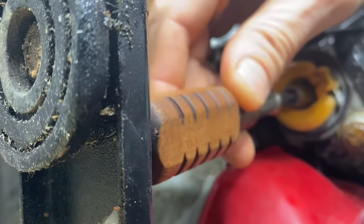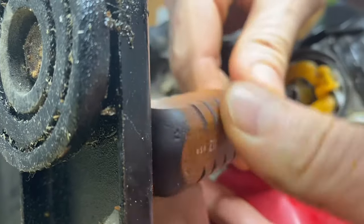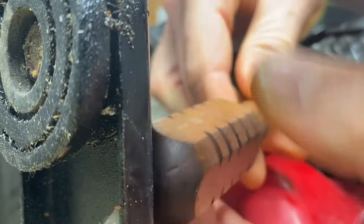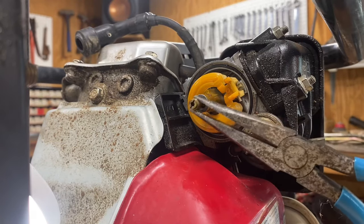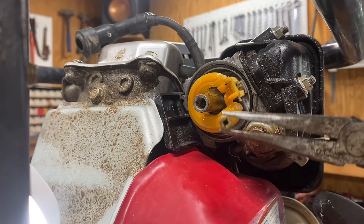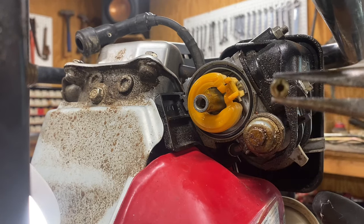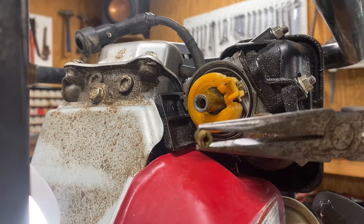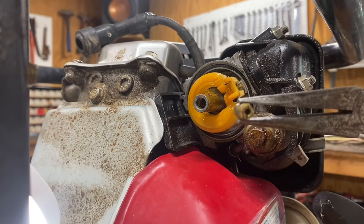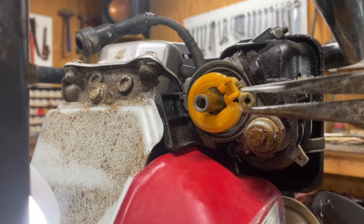Get one that fits in there - this one's just about perfect. It's going to take a little work - you'll turn it around, you'll feel where it grabs. It's going to be tight in there because there's a lot of carburetor goo and gunk. So I've wiggled this main jet out. You're going to screw it as far as you can, but after that you're going to need a little gravity to let it drop down. When you look at the main jet, this is what the fuel sucks up through the bowl into the jet - it should be clear, you should be able to see through it. But as you can see on this one, she's totally clogged. You should be able to see a little light through it but we're clogged up. I'm going to show you how to clean this sucker out and get the lungs back on this old girl.